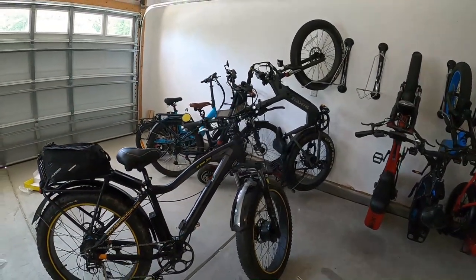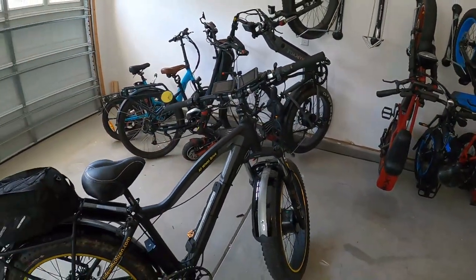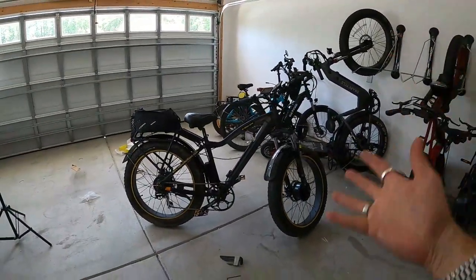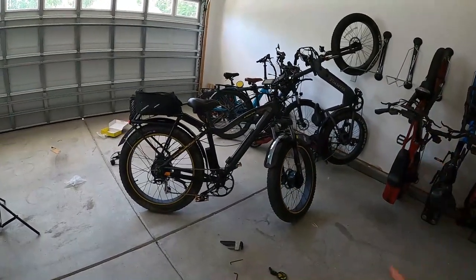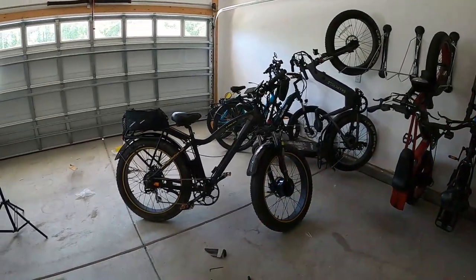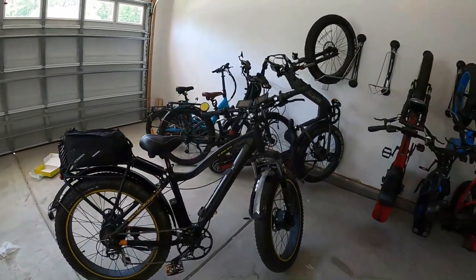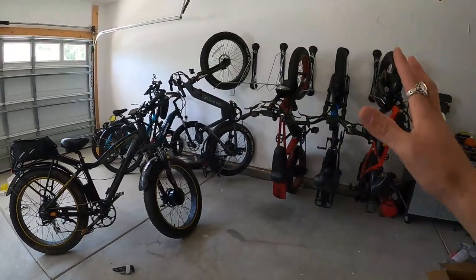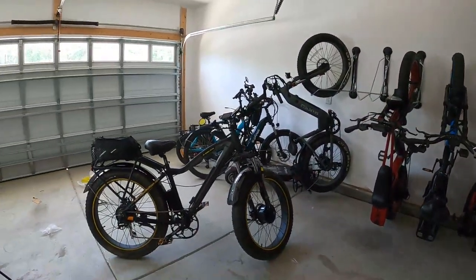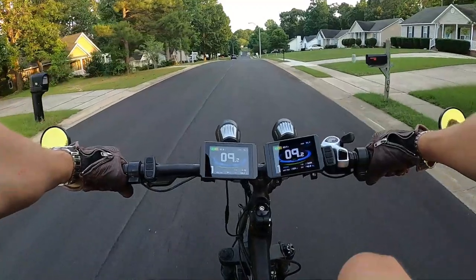I think these brakes shipped from maybe the UK, so maybe overseas they have brakes on the opposite sides. I like the rear brake on my right hand so I just put it on upside down and it seems to work fine. The only issue will be if I ever have to bleed it - I'd have to flip it upside down so fluid doesn't fall out. Crazy easy - I'll link it in the description. I don't work for them or get anything if you buy them, I just like to show you guys stuff I like. We'll go out and do some testing to make sure they can bring me to a stop way better. I'll link the Steady Racks too - a space-saving solution to hang your bikes on the wall.